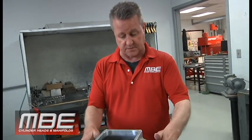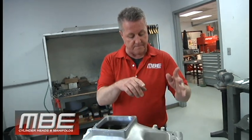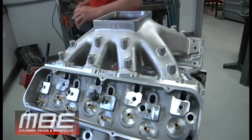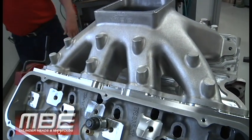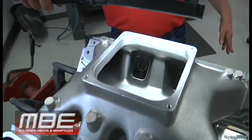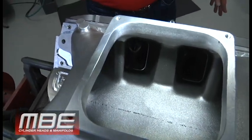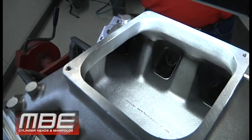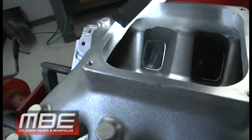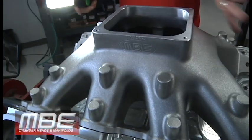We can do these for your cylinder heads or our cylinder heads. The intake port on your cylinder head will have to be matched to the intake port on this manifold. If you look inside, you can see the small radii — that's what helps it run, helps it a bunch. The air stays attached longer. The end runners are large, and it comes into a common plenum, just like we did on the big nine.